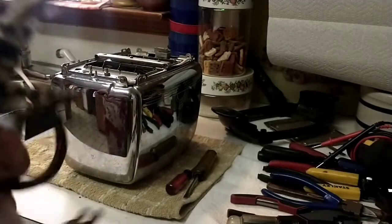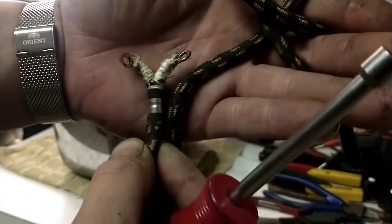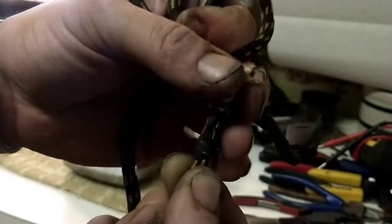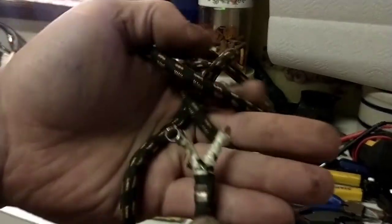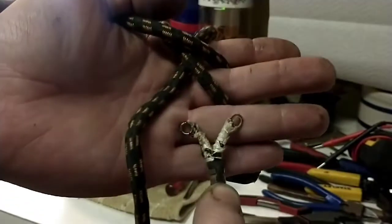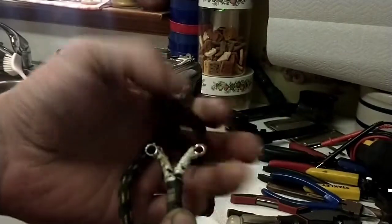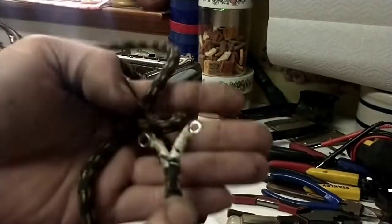With the old wire removed, you can see originally they used little ring terminals formed with wire with a crimped eyelet, and you can see the asbestos insulation, which is really cool. And this small exposure is not going to do me any harm. Usually you have to work in a shipyard or a mechanic around antique brake dust to have any problems with asbestos. But definitely don't put this in your blender and snort it. That's not good, because once this stuff's in your lungs, it pretty much stays there and accumulates. And you get enough of it, it'll lead to mesothelioma, among some other issues.